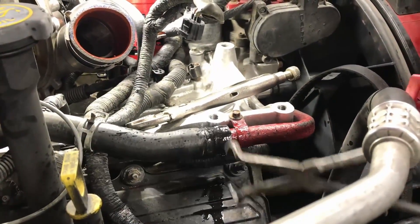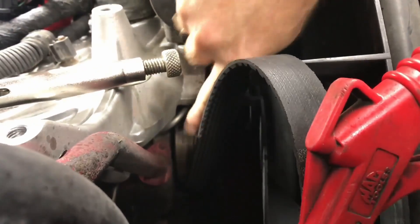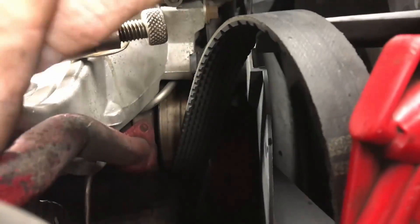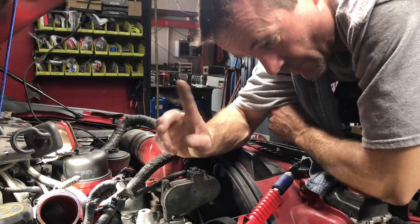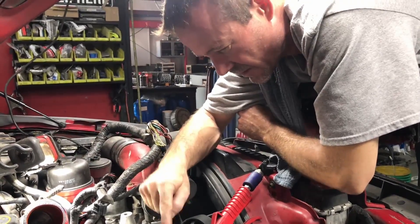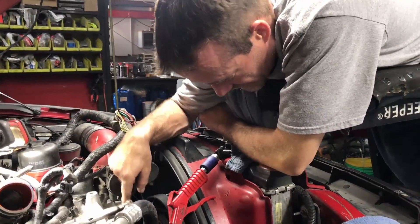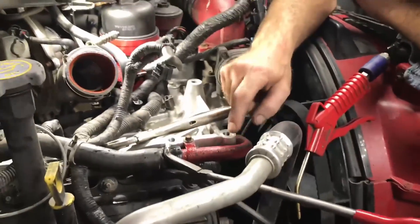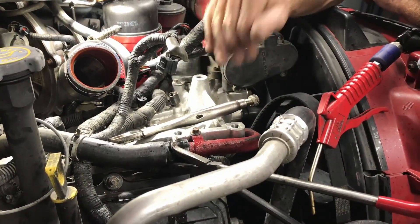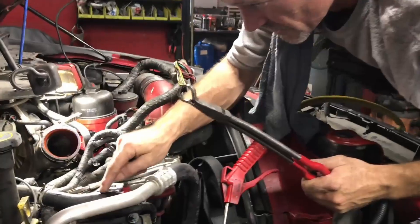In the cab lift video I took this off and it came off real easy. Now this one is an O3 — look down here, you can see that bolt broken off right there. The head has broke off the heater core tube. I have destroyed front covers before on O3s trying to take these out. What I see right here is red paint over the broken part of the bolt — we obviously ghetto rigged it. If you've got an O3 you might want to consider leaving this alone unless you're willing to do actual work on the front cover.